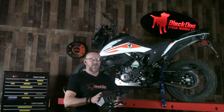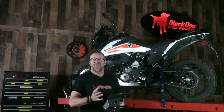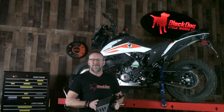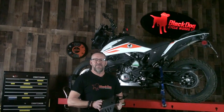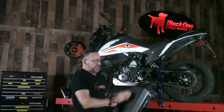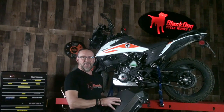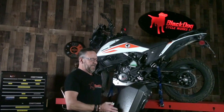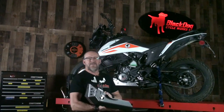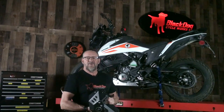The material is 5052 aluminum, which is 3/16 inches thick — a very stout material that we use on all of our skid plates, and it's definitely proven itself to hold up over years of abuse. It has full coverage, as you can see. The bottom is solid. It creates a glide plate to get over obstacles, and you don't get hung up on things that will get you high-centered. It also makes an excellent platform for doing maintenance on the bike if you have to lift the wheels off the ground to change a tire or upgrade the suspension.